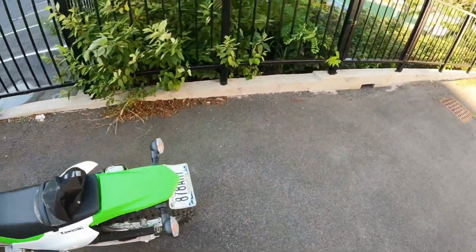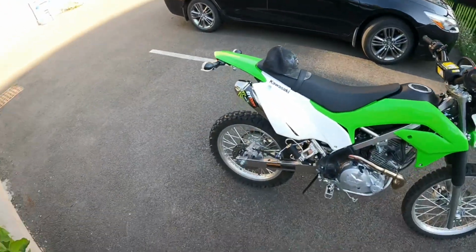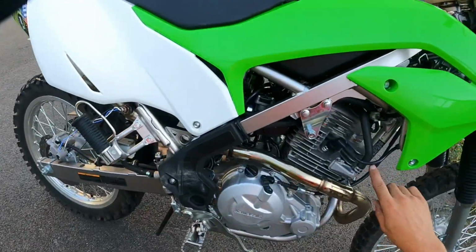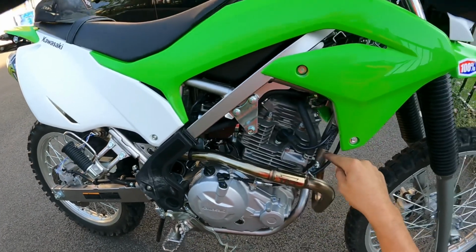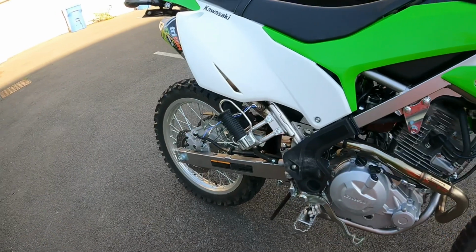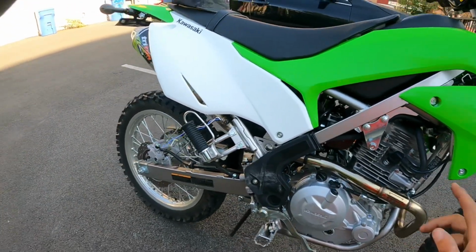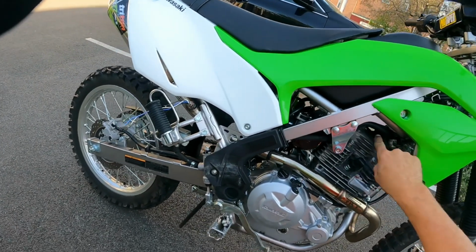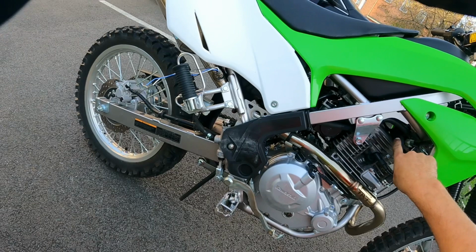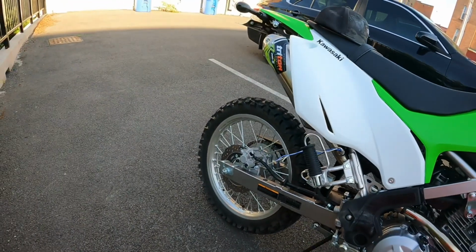So like I said, the pair system delete gets rid of that backfire. It's these right here pumping fresh air into the exhaust head. It's an emissions thing, but with the delete, it won't show a check engine light. It's like $25. All you do is unhook those, plug them, and plug a little transmitter into the plug itself, and then you won't have those backfires.